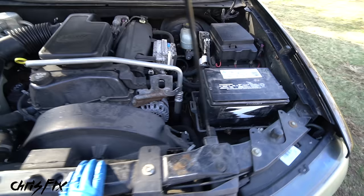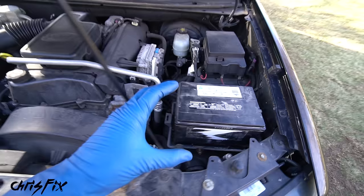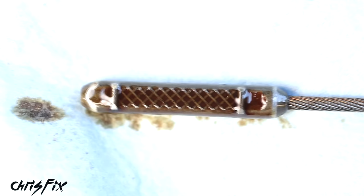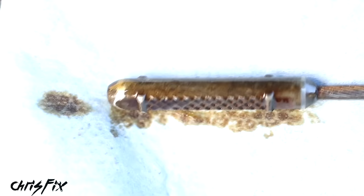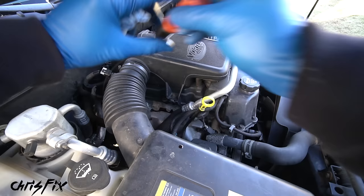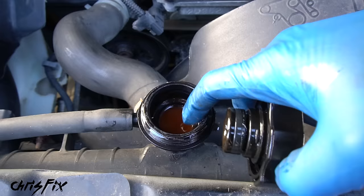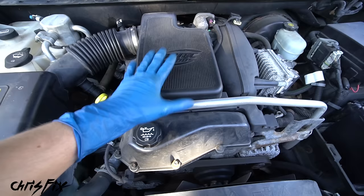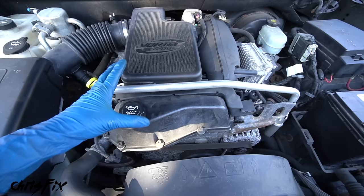What I'm concerned about is getting this car running. When I was at the owner's house, I couldn't get it started — I couldn't even get it to turn over because the battery was so dead. I tried attaching jumper cables and a charger, but there wasn't even a click from the starter. That said, I did check the car's vitals: the oil had no froth indicating a head gasket leak and was fully topped up. The transmission fluid was filled and somewhat pink. The coolant was topped off, not rusty, and was the correct Dex-Cool. So engine oil, transmission fluid, and coolant all looked normal, but that doesn't mean the engine is good — it could still have low compression or other issues.